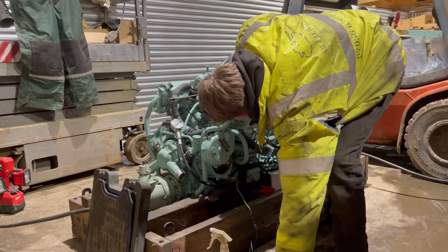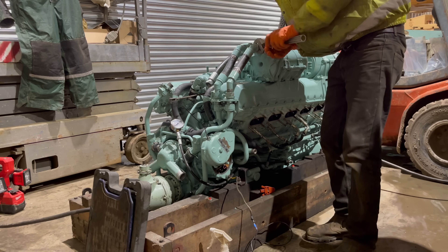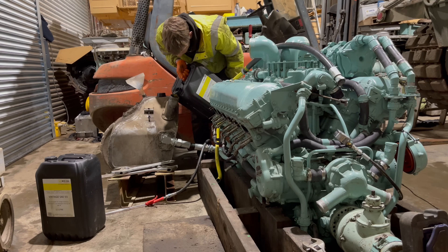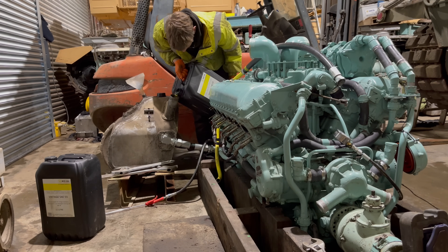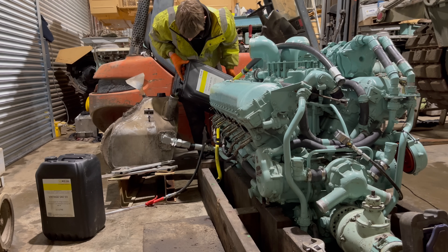The oil's now had plenty of time to prime the pump, so I'm going to put the filter pipe back on and connect that up nice and tight. Next job is to fill the engine oil tank. This would have been a lot easier if my dog hadn't chewed up my best funnel for this, but I did the best I could.